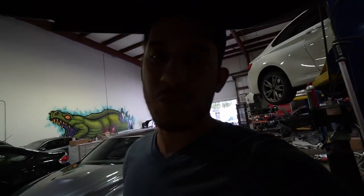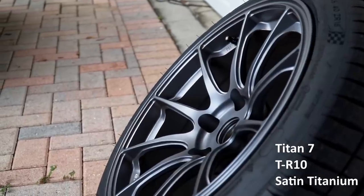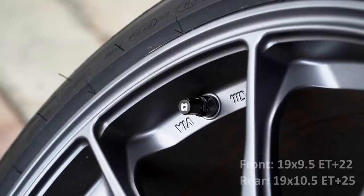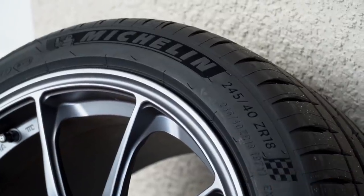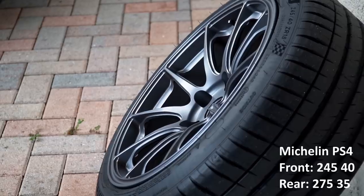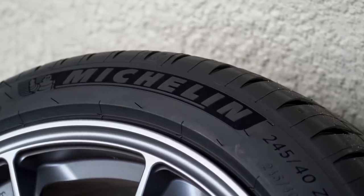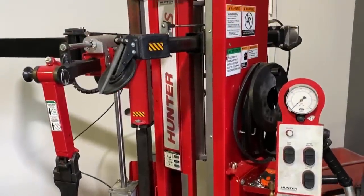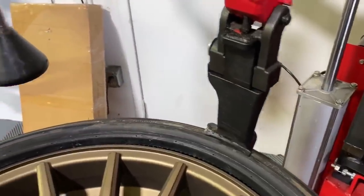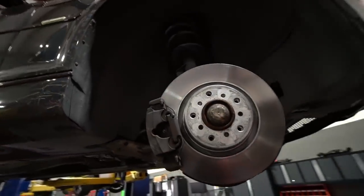While Ali takes care of the suspension, let me show you what the wheels look like. These are fully forged Titan 7 TR10 wheels in a very unique satin titanium color. The specs are 18x9.5 with a +22 offset up front and 19x10.5 with a +25 offset in the rear. For tires I went with the well-respected Michelin Pilot Sport 4S — 245/40 for the front and 275/35 for the rear. The cost for the wheels is $2,100, which is quite the bargain for track-focused fully forged wheels. They're mounted using PSI Orlando's tire mounting machine, which protects the wheels during installation since the contact parts are plastic.